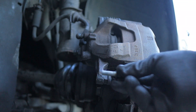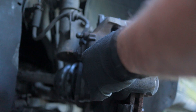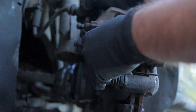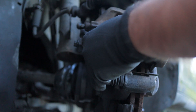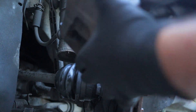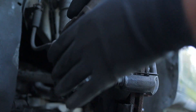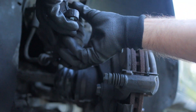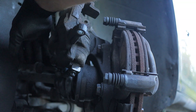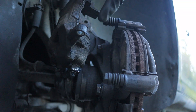That's your second one — it is going to be stuck a small bit, which is good because you don't want to slacken it off. I've loosened this rubber brake hose as well. Just slide it off as you can see — that's your caliper there. I'm going to try and just hang this off here so there's no pressure on the hose itself, and the caliper is just hanging there. It's not ideal but it does the job.